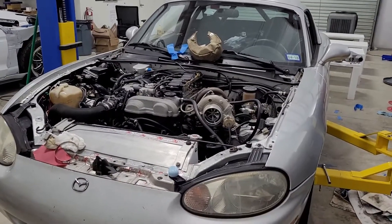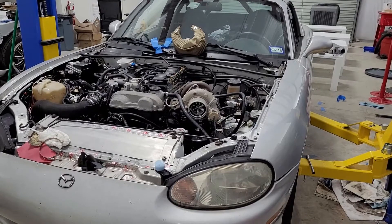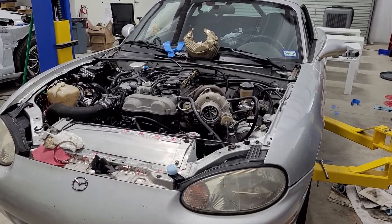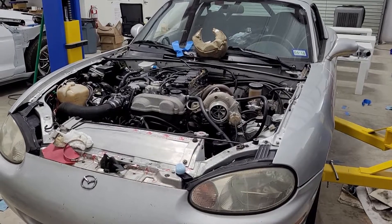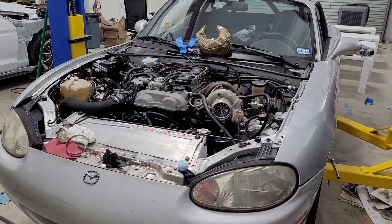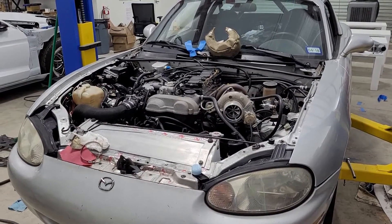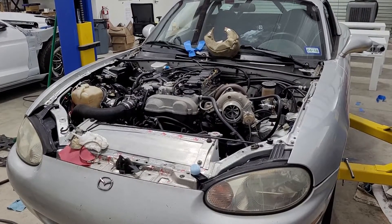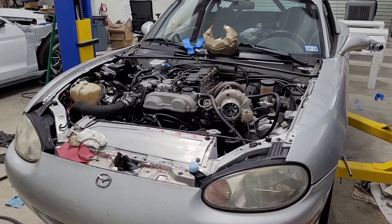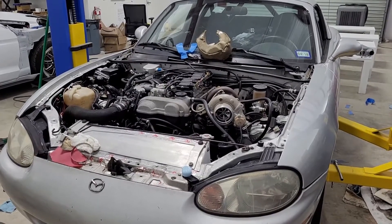One day I left the car running for about six hours and finally caught it — I heard the pump shut off and then a few seconds later turn back on. Sure enough, while idling, it finally just shut off for about 45 seconds on its own and then came back on. That's when I knew: the intermittent oiling issue I'd been having was just the pump turning off. Right about that time the car had sat, so I decided to pull the turbo setup out of the back completely. Hopefully this real-world experience helps you make your decision on building a compound turbo setup.